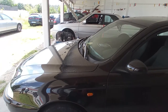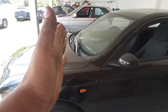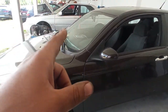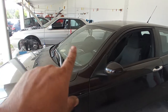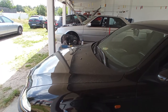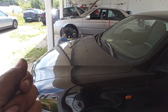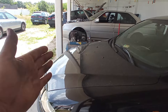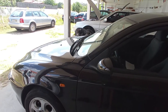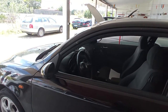Some of you guys may say, well, why can't you just clean out the things on the engine bay area and leave this behind and try to see if it works? It will work, I know that, but as soon as those silica spheres go again into this side, the compressor will have more problems again, and also we start to have problems with compression because the silica will create wear on the sidewalls of the cylinders of the AC compressor, just like on an engine. So in order to do this properly, you have to take everything out and do things just one time, okay?